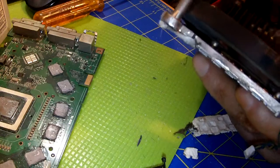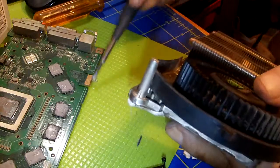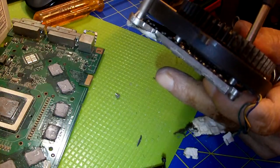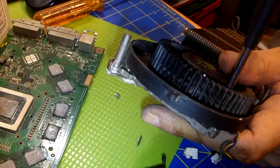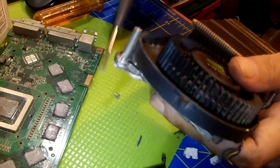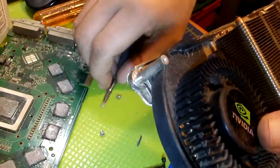A lot of people won't get rid of cards when a lot of times there's no problem, or they kill a card because they don't know they should, one, blow them out with some dust off, and when you do it, you should have a vacuum running with the hose in front of your computer sucking dust up.